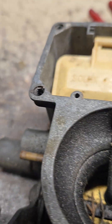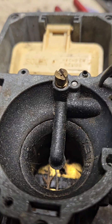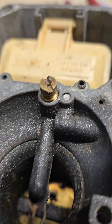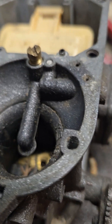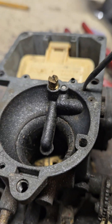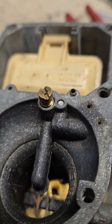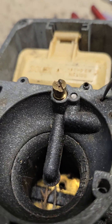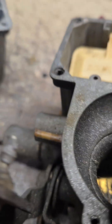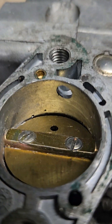Remember: if you plug the air correction jet you get just gas, and if you plug the fuel side you just get air. When you make the jet bigger, a lot of guys do that and it usually doesn't make any difference, because you have to give up more air — the air-fuel combustion ratio is 14-point-something to one. So if you make the fuel jet bigger you've got to make the air correction jet bigger too. With more air coming in, you're going to get more volume of mixture coming out of the ports, and the mist will be denser than before you changed the pilot jet.